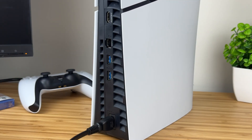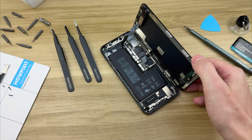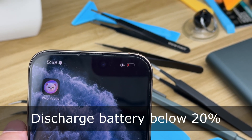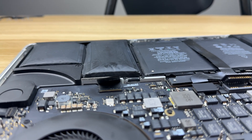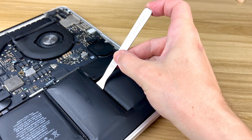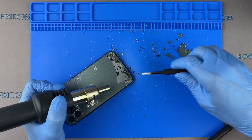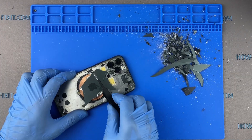As for safety, always disconnect power sources first to avoid shocks or shorts. Always remove the battery from the device first — if the battery is inside the device, locate the connector and unplug it right after opening. If it's still charged, try to drain it below 20% before working on it. A charged lithium-ion battery has a risk of short-circuiting. Be especially careful when handling swollen, punctured, or damaged lithium-ion batteries — they can catch fire or explode. Don't use sharp tweezers when working with the battery. If you're unsure, it's better to leave it to a professional or dispose of the battery at a recycling center. And wear safety glasses if you're dealing with a shattered screen or removing the back glass, as tiny shards can fly up when you're prying them off. If you're using heat guns or soldering tools, work on a heat-resistant silicone mat to protect your workspace and components.